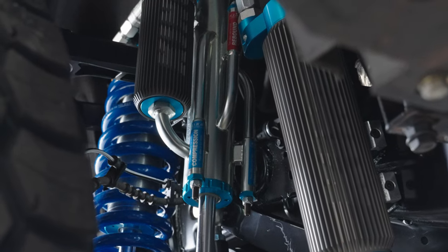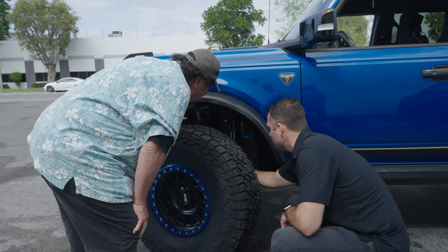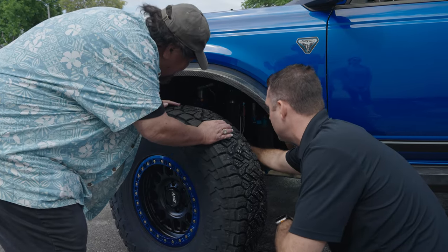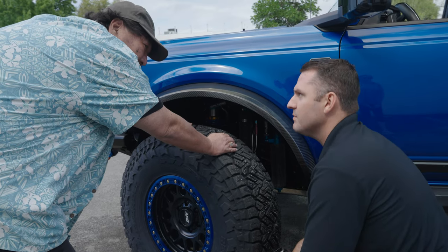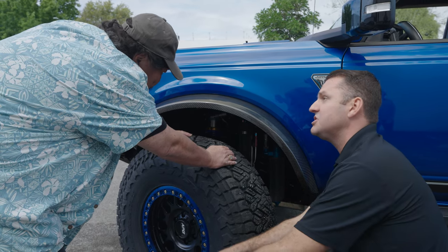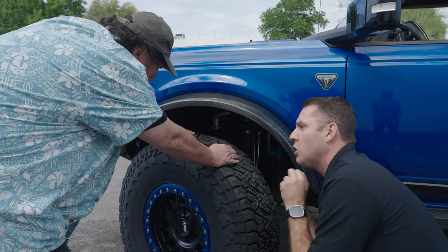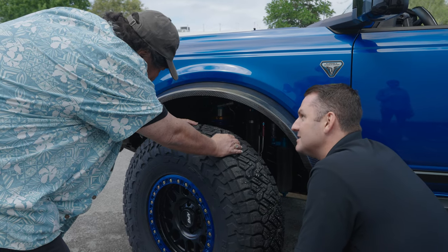If you ever happen to run out of compression on the primary, you've got this beautiful bypass shock that's got four more modes of adjustment without tearing the system apart. Loosen the jam on these guys. See how these fins — there's one here, one there, one here — those are three different stages of compression. So you can stiffen up stage one, stage two, or stage three of compression. It's adjustable all the way throughout the travel. If you're hitting something and springing out high, that's your rebound settings. This red rebound tube is going to speed up or slow down that extension. Anytime you unload off of an impact, the spring and gravity of the car is always going to want to push itself and extend. So the rebound settings within the primary and secondary adjustment slows down that rebound. Highly customizable for you and your application — we've got this set up based on how you told me you're going to be driving the car.